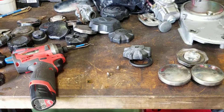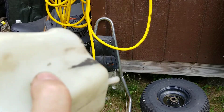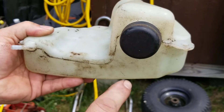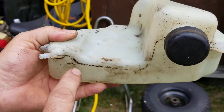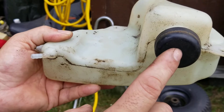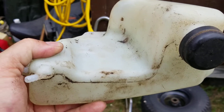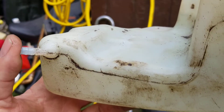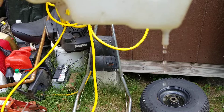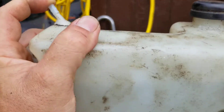For this experiment I'm going to use an old oil tank I have kicking around. I filled it up with water — that's why it's on its side. This is a non-vented cap because it gets its vent from here. This vent is simulating your fuel cap. I'm going to show you why your bike runs and then slows down and dies. I'm blocking the vent with my finger right now — watch the water slowing down to a trickle.